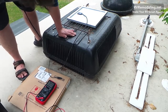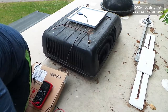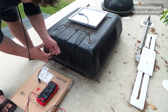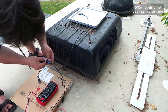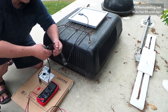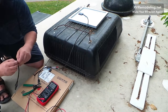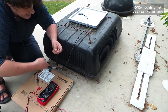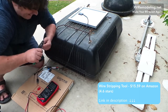We don't need this much wire, and we don't need that much wire on the cable that we bought. We're going to strip this part — there is a fuse here, maybe we should keep that. Actually, we don't need to keep it because there is a fuse in this RV just for the solar, I know that for a fact. So we're going to cut this about 10 inches long, strip each end, and then connect them together. I do recommend having a good pair of wire strippers.